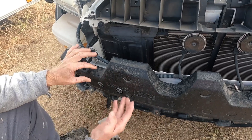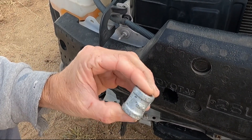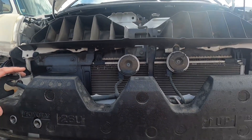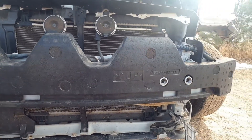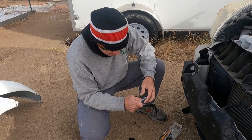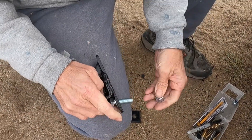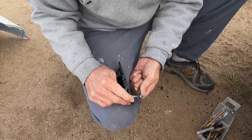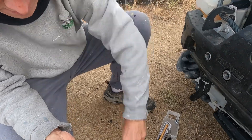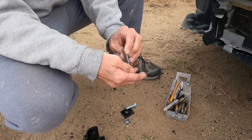What I did was I drilled out holes in the foam and then I bought some galvanized spacers to extend the bracket out. Now I have four of these that line up with my holes on both sides. I'll need to drill two holes on each side of the skin where the bolt and bracket will go through. These are the bolts that came with the kit - they would normally mount through the reinforcement on the inside with these little square brackets and a nut. Since I'm using this extension, I had to get longer bolts with the same threading and same strength.